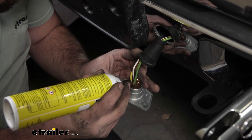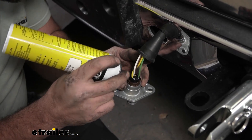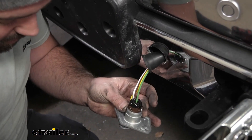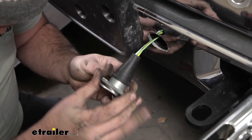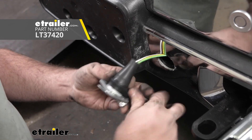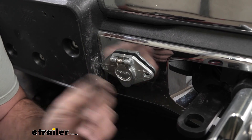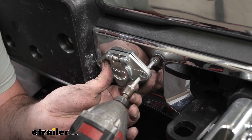The six-pole sits on the front of the vehicle and gets exposed to a lot of weather, so a little bit of RTV silicone — just kind of fill up those gaps — is going to make sure moisture doesn't get in there and break it down prematurely. Once that's gooped up, take your boot and slide it over. To make sure it lasts a long time, I'm going to take some electrical tape and wrap it around where the boot is so it doesn't slide off. You can choose to back-fill this if you'd like as well. Now we need to mount up our six-pole — I used a step bit to run it through here, which makes for a nice mounting point. I'm going to be self-tapping this in.